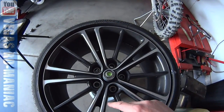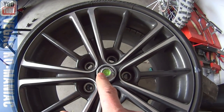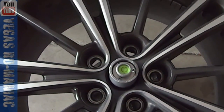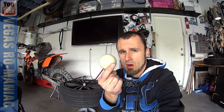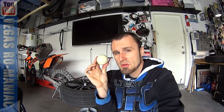I've turned the tire around and you can already see the bubble is pointing off to the side — the bubble balancer is telling me it's not balanced at this point. But because I'm a little insane, there is another way of balancing them: with a ball. This is a billiard ball, one of the roundest things you can buy for very cheap. I'm going to try to balance the tire using one of these balls instead of a bubble balancer and see if this gives me better results.